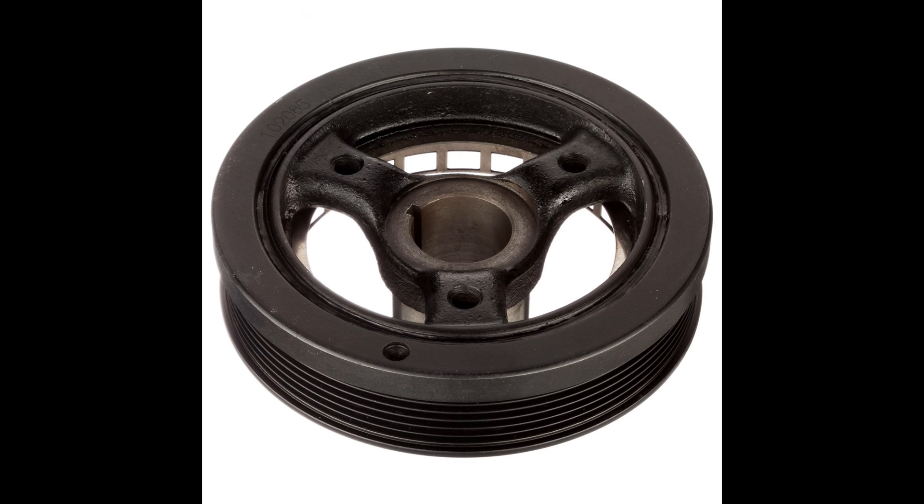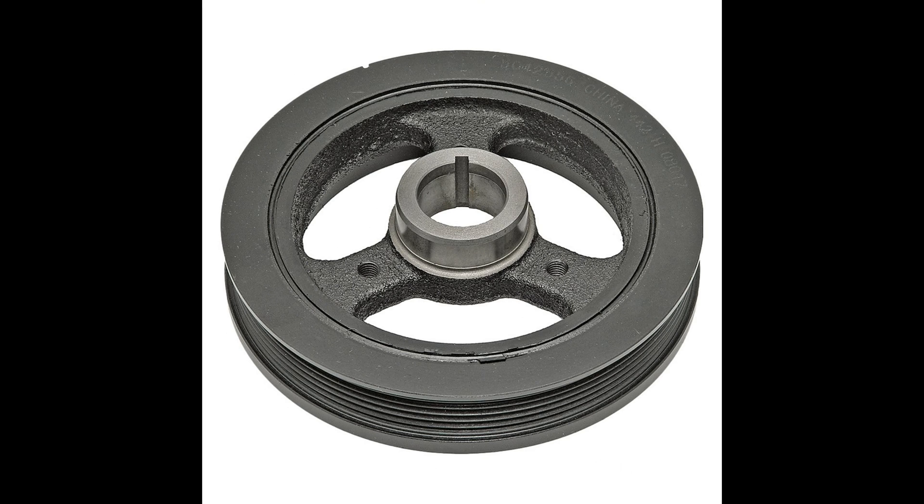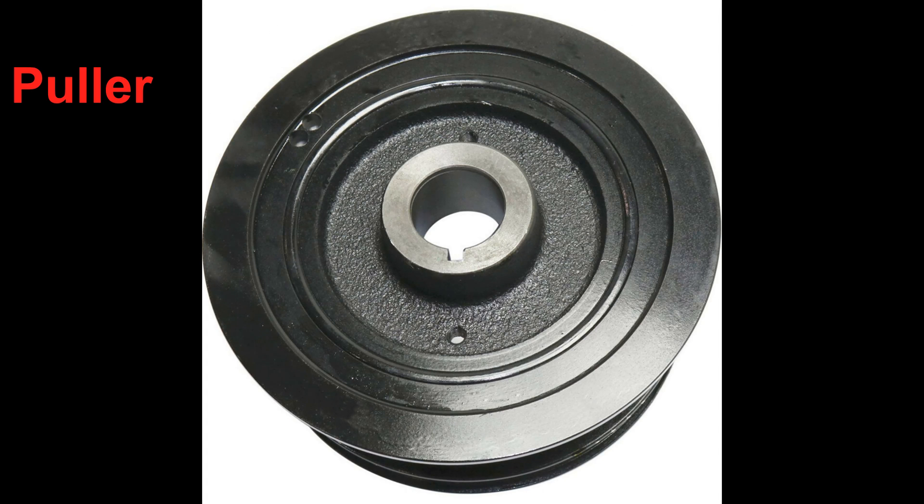So what's the difference and how do you tell? These next three images are images of a harmonic balancer. If you put those images beside the images of the pulley, it can be quite difficult to tell the difference between the two if you don't know what you're looking at. One of the easiest ways of telling — and it's not foolproof, but it's accurate most of the time — is that a harmonic balancer will have threaded holes somewhere near the hub in order to fit a harmonic balancer puller, whereas a pulley will not. The reason for that is, a harmonic balancer must be an interference fit with the free end of the crankshaft, so that torsional vibrations can transfer effectively and in their entirety into the harmonic balancer itself. That's not a requirement with a pulley. So basically, if you can remove the crank pulley retaining bolt and pull the pulley off by hand without the use of a harmonic balancer puller, then it is a pulley and not a harmonic balancer.